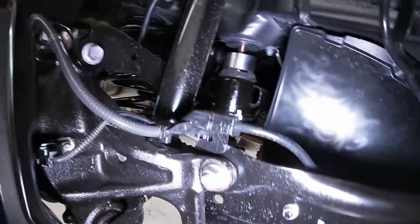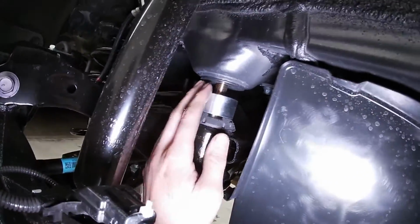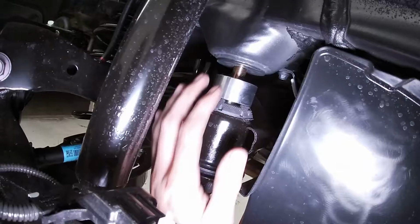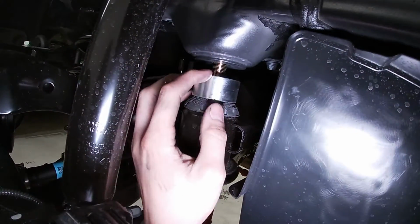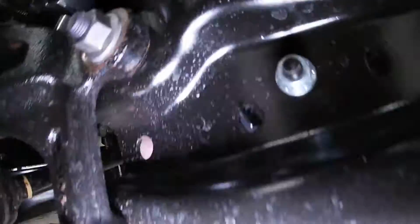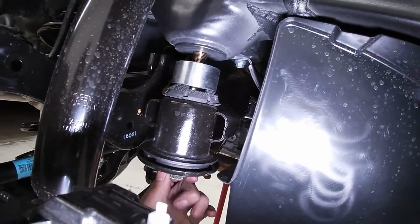In the front end portion, we have the original setup. They are a bolt setup, unlike the rear, which is a stud. So we have these totally down. We put in the new supplied 1-inch spacer that goes between the subframe bushing and the body. And then they have a new supplied washer and bolt. So we have those in there just real lightly.